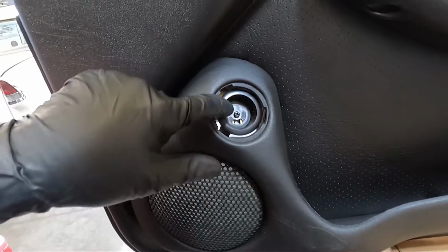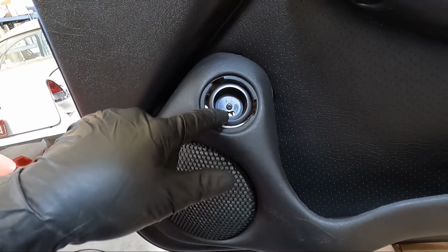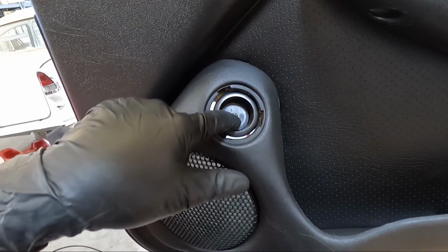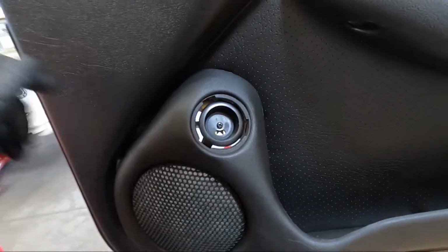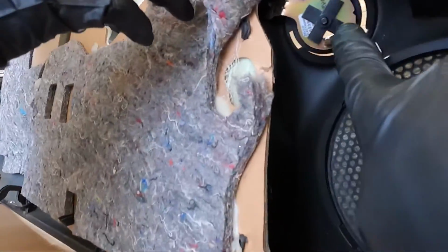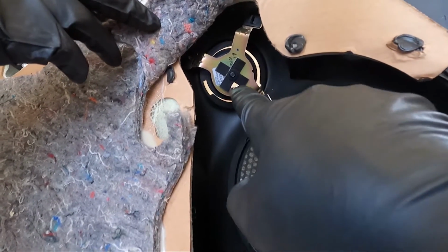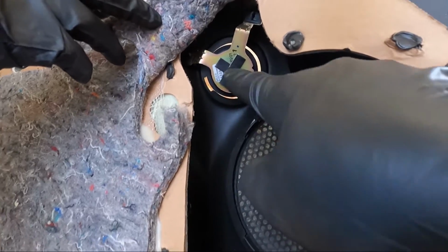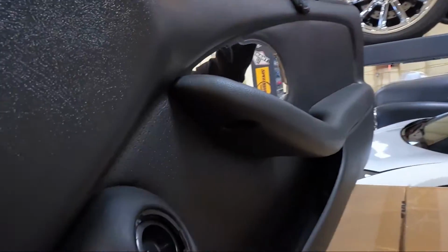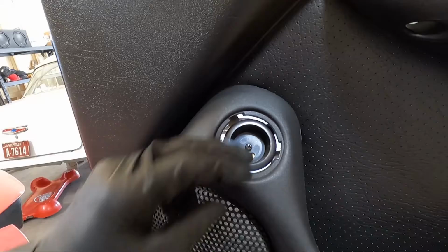So here's what I've done. I've taken the smaller tweeter holder, and I used it. I put the screw that came with the kit through that original bracket that the old tweeter screwed to. Now, on the back side, because this thing comes with this bracket to hold it up against something, I trimmed the edges off, and so now my wire is going to come through the bottom. We've got it screwed on instead of using two-sided tape. I'm sure two-sided tape will probably hold it, but I just like this better. I just think it looks a little more professional.